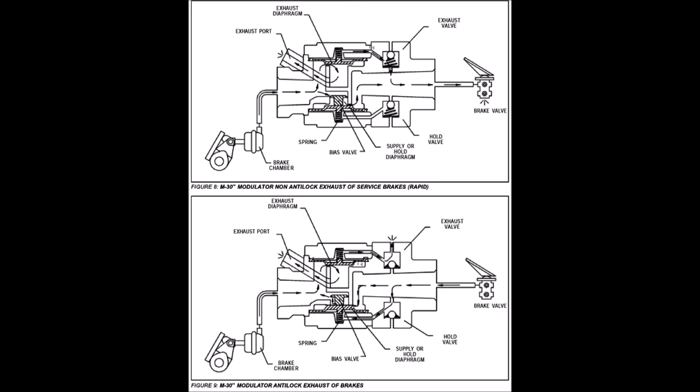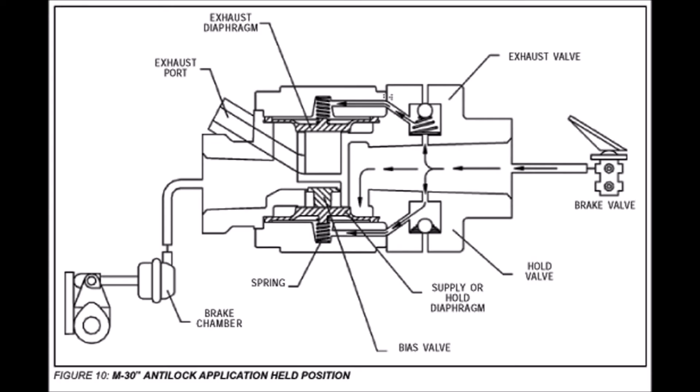These valves have nothing to do with parking brakes. I first noticed I had a problem when I was backing up my truck — air supply was dropping fast and I didn't know why. Finally I traced it to my left rear ABS valve.